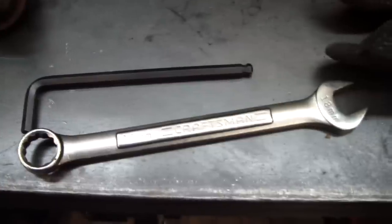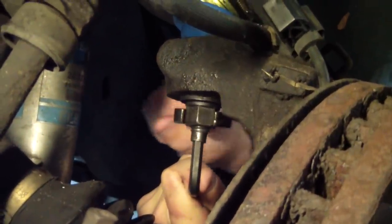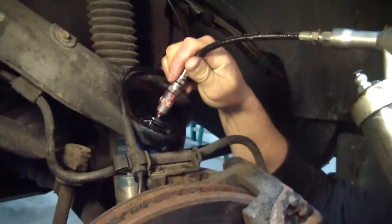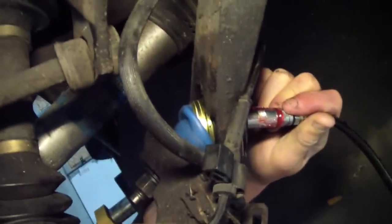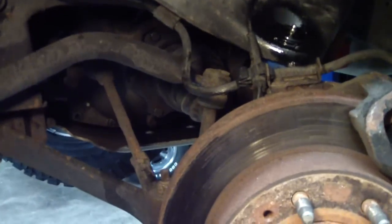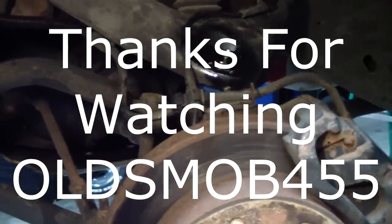We're trying to tighten the nut on the new one and it turns out the shaft is spinning on the new one as well, so we're going to use the Allen key. We couldn't get an Allen socket in there and a wrench — we'll probably put a torque wrench on it in the end to try to torque it to spec. Here we're fixing this wire back on the control arm. We mass-painted the ball joint so it doesn't rust. We'll go ahead and grease everything on the truck and set the torsion bar back to where it was. And that's about a wrap for the ball joint video — thanks for watching.